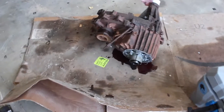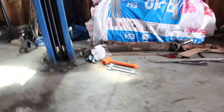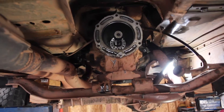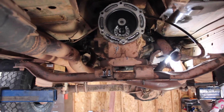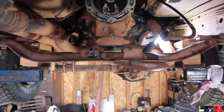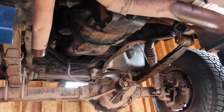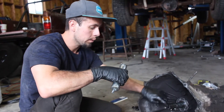The transfer case is off. I managed to spill a bunch of gear oil right through the holes of my crocs, which feels great. So transfer case is out. I'm going to crawl up in the truck and take the shifter off at the top, then brace the transmission. I'll cut the exhaust and bump that out of the way since this 350 has a crossover pipe that's not in a good spot - looks like it's custom. Then I'll start working on the bell housing bolts and removing the cross member.